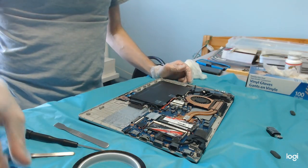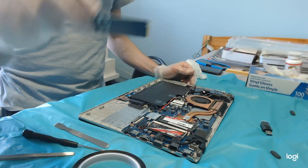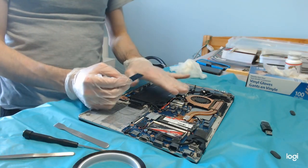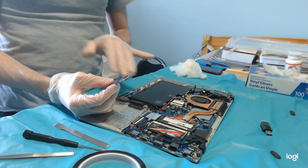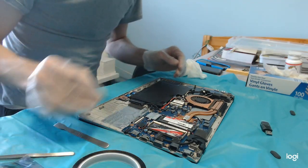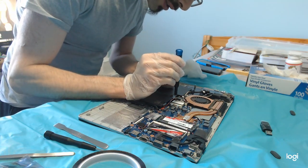Why can't I put the second drive as USB? Well, I don't want an external drive with important data on it to dangle all the time. And drives are not very reliable through the USB channel. I had a lot of problems always with USB drives. I want drives to be natively communicating with the CPU rather than passing through PCI Express to USB bridges or SATA to USB bridges. So let's get rid of these two. Of the Wi-Fi card.